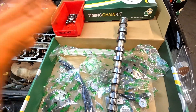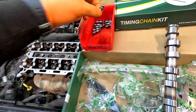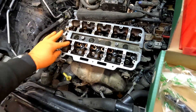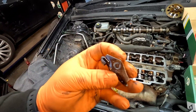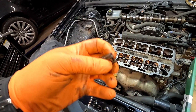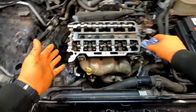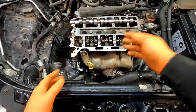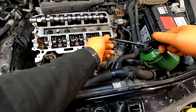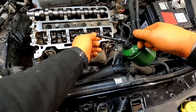We've got all the new parts that have turned up - a BGA timing kit and a BGA camshaft. They only do an exhaust one; whether it's been superseded or discontinued I don't know. We've squeezed a tappet to show they're nice and soft. We're going to put these in now. A lot of people will say you need new rockers - my personal opinion, these are fine. I've checked all the rollers, they're nice and flat with no funny surfaces and no play in the needle bearings, so they're going back on. Once the lifters and rocker arms are in place, give everywhere a clean with blue roll, make sure there's no debris where the camshaft sits, then give everywhere a squirt of oil. Engine oil will do the job fine for now.